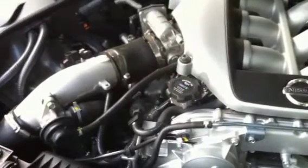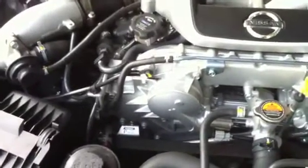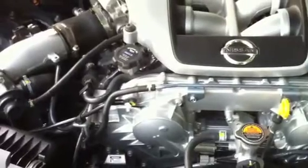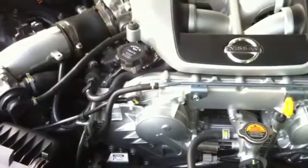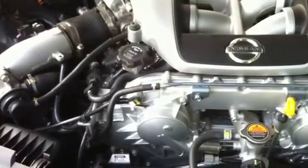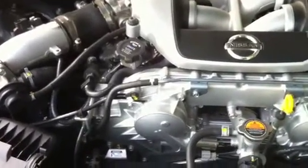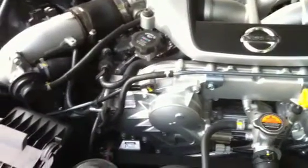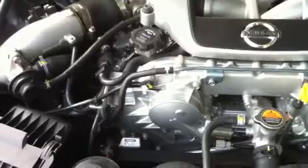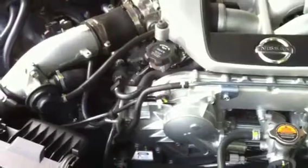In the downpipes, as they come out of the turbo, you won't see them, they're all under all these heat shields under the side here. You've first got a wideband oxygen sensor or lambda sensor. This will tell you what the air-fuel ratio is coming out of your engine on that side. The ECU will use that to correct your readings so that your fueling is hopefully correct. It has a limited range, so if you go too far out of sync with the mapping of your injectors, of your intakes and so on, then you'll end up throwing a code and the car will run rubbish.